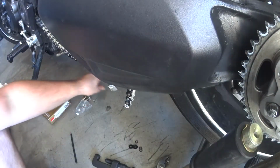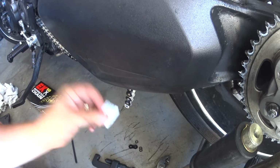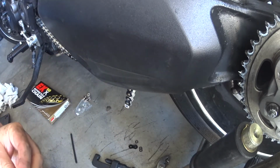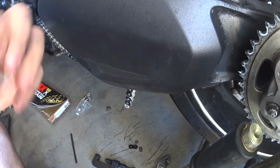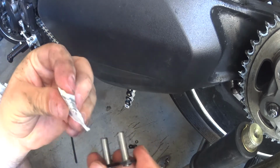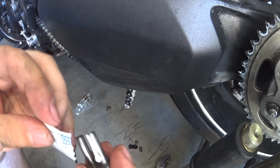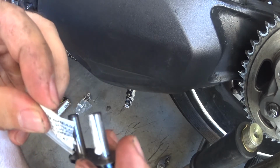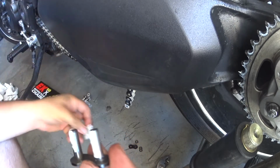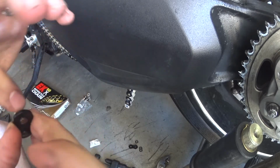So now, you want to pull out your master link and the packet of grease that came with it, and tear open the grease. You want this master link to be thoroughly greased up. So, you want to take a little goober there, and then use your finger to spread it all the way around,